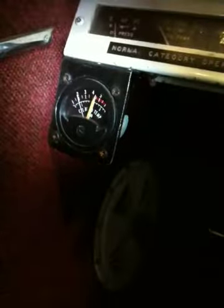On the dual yoke, you have aileron trim, and then below that you have the verniered power, mixture, and propeller controls, as well as your ignition, and then your trim is also located down there below with your cowl flaps. You have several fuel gauges over here on this side. You've got an aux fuel, a main fuel, and then you have your ampere meter for the alternator. And then over on this side you have some more engine instruments: oil pressure, oil temperature, and then you have cylinder head temperature and a separate gauge down here.